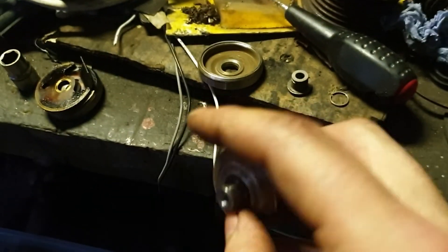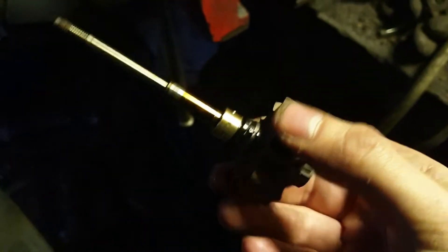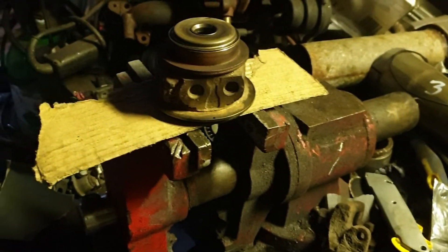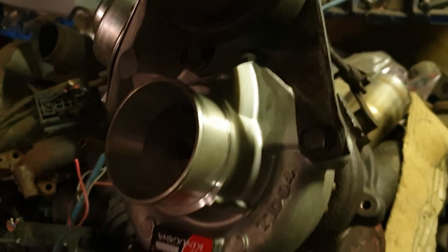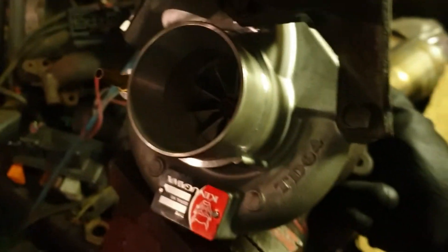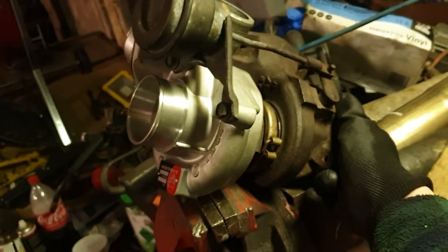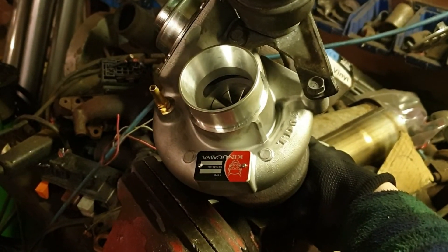I'm going to do a bit more work on that before putting it back together. Cleanliness is key. One thing I cannot stress enough: never ever put these back together bone dry — you'll have a very short life with it. Always keep them well oiled when putting back together. Tons of oil in it, and even before I start I'll be priming it with oil. Right, it's all back together. I'll do another video when it's fitted to the car. Take your time, go nice and slowly, and use this video as a guide rather than a strict how-to.